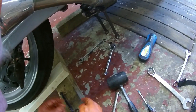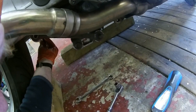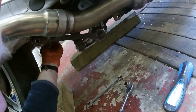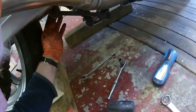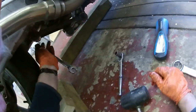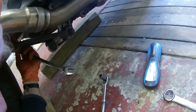Next thing is to put in the dog bones. Slide that in there, have the nut on this side. Second dog bone goes over like so, sits onto the bolt that's there. Fasten the nut in on this side — 17mm wrench here, 14mm on here — just do that up sufficient to keep everything in place. We can take the bolt out of here along with the washer and slide these up. There we go — we can see we've got good alignment. That's all our suspension components popped in.